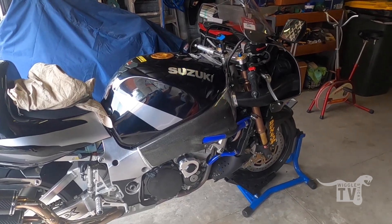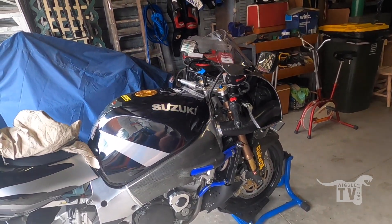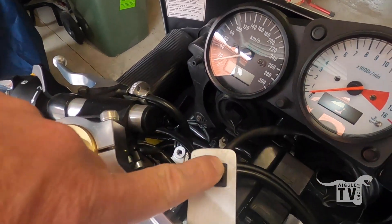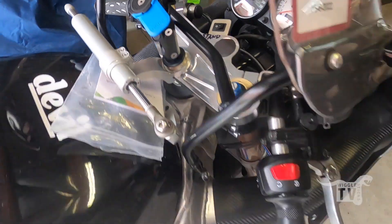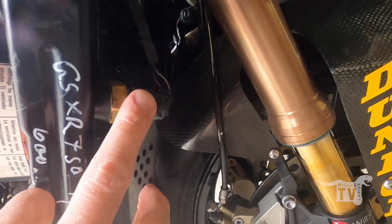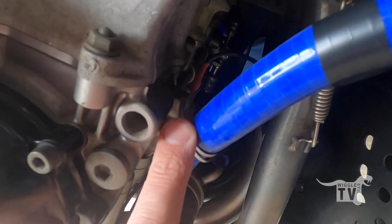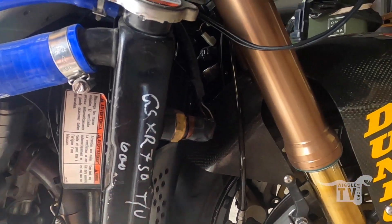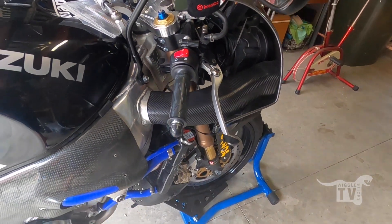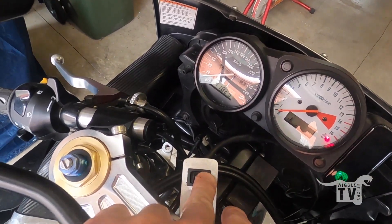I think the fault is probably a weak spark when hot. So what I've ended up doing is rigging up a switch so I can manually turn the fan on to try and prevent it from actually getting hot. We've got a standard on/off switch on the dash here, and down here I've just tapped into the thermo sensor wiring at the back and essentially ran an earth off the engine. It's essentially just bridging the earth between this plug, so now when I turn the switch on everything fires up as normal.